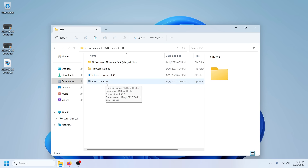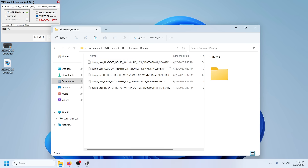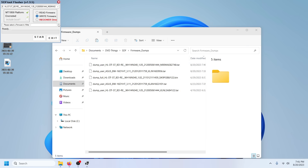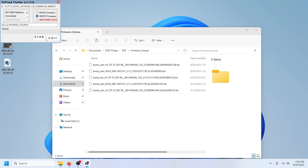Just like before, we're going to come into our SDF Flasher tool. I want to read the firmware again to make sure I have that backup. It's telling me it's a compatible chipset and encrypted — things I don't think matter anymore. Checking the firmware dumps, we got another one in here. You can see there might have been a very minor revision from the last one I did almost four months ago. So I've got that firmware dump now — same deal as before, we're going to select a firmware to write. Everybody says to flash the WH-14 drives to WH-16, and the MK is the MakeMKV firmware, so that's what we want. Hit Start.